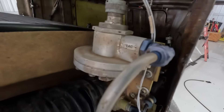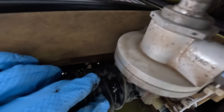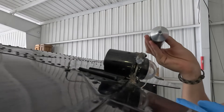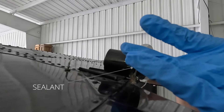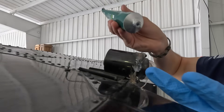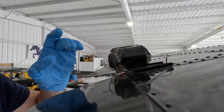So that boot crack that we talked about in the last video — I'm applying sealant there and patching that up, so that was a quick and easy fix. And then here on the position light I did find some open gaps, so I'm just going to go ahead and use some silicone and patch that up. Quick and easy fix. Just apply it on, make sure it's smooth and even, and then let that dry.